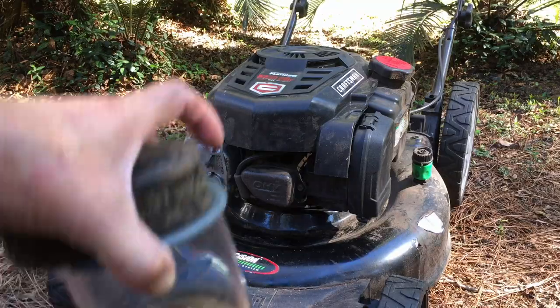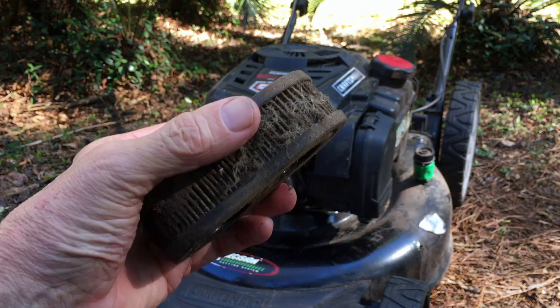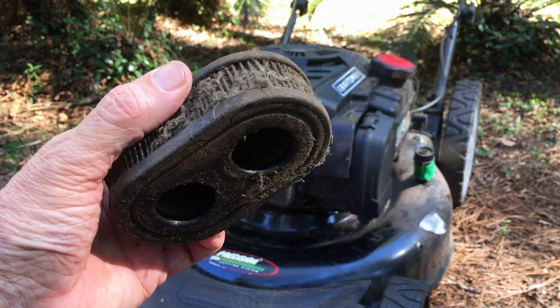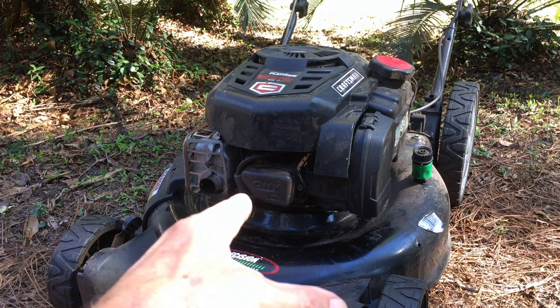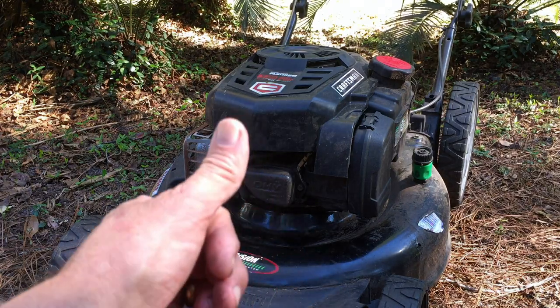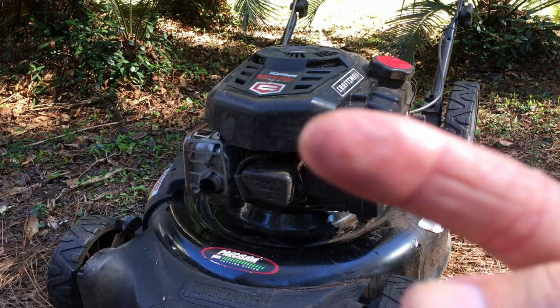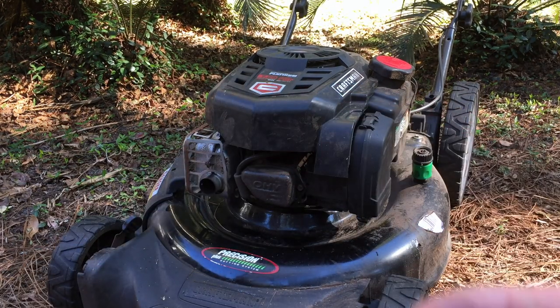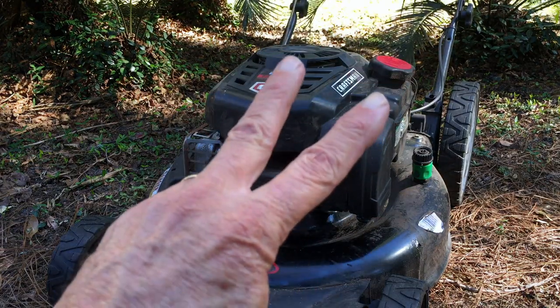This mower is back running halfway decently after being 14 ounces overfilled with oil and having an air filter that the previous owners apparently never changed. The pull cord snapping back turned out to be the valves needing adjustment — specifically the exhaust valve up top. You saw how loose that was — easy fix. There's a link to the Snapper video in the top left. That one was a main jet and automatic choke issue. Hope this helps, thanks for watching.